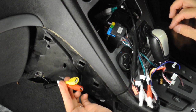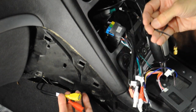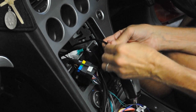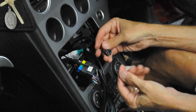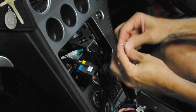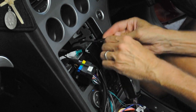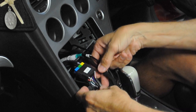I've run the USB cables down the bottom so I can plug them in, run the GPS around and stuck it to the window. The main antenna from the car — which I'm going to replace — has a different connector system to the standard one. You get an adapter with the head unit; the standard pin type adapts to the Alfa's system, plugs in and pushes in hard, then that goes onto the back of the radio.